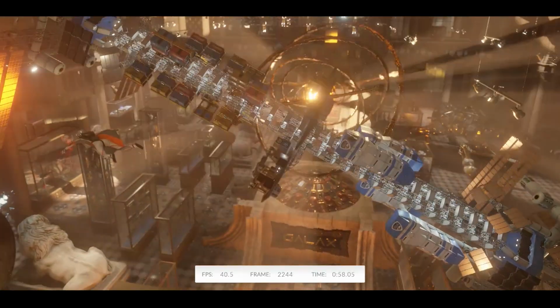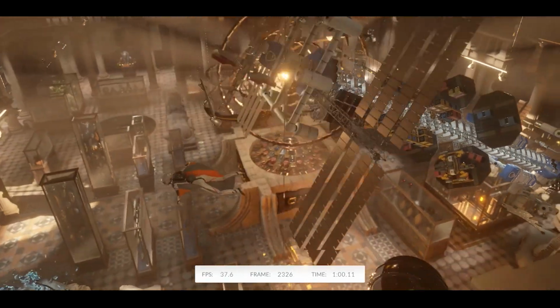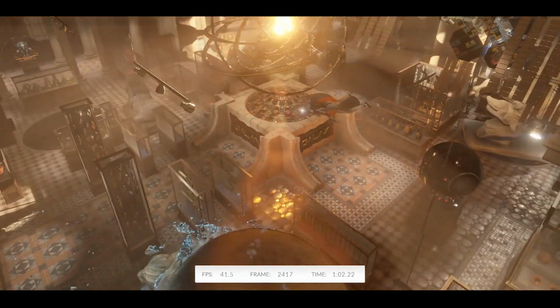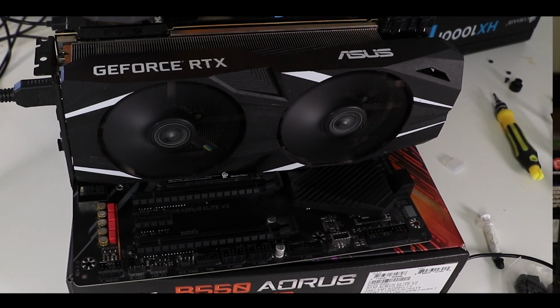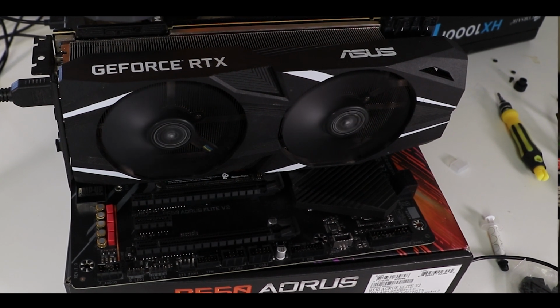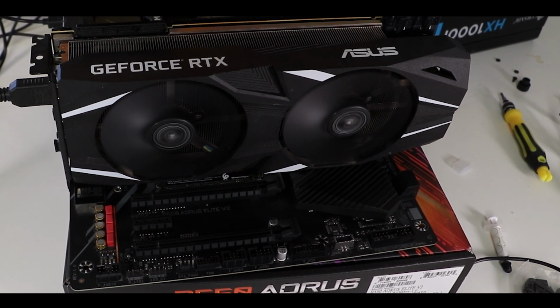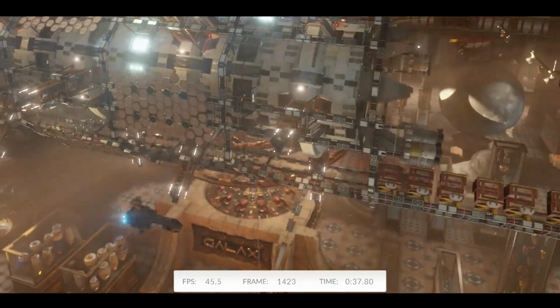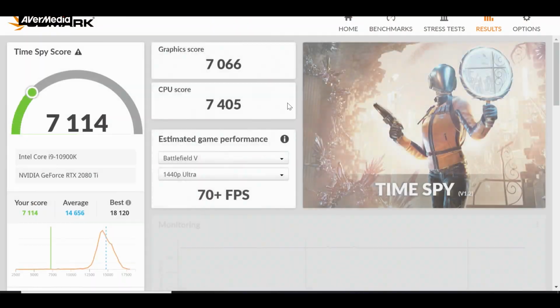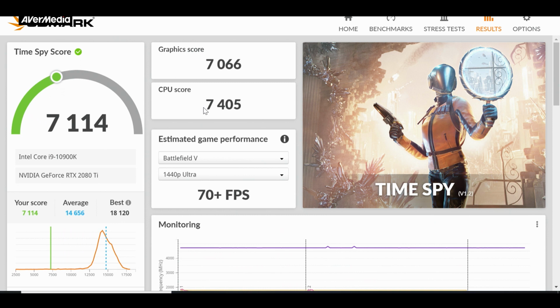Now, for my diagnosis, I have decided first to do a full 3DMark run on Time Spy whilst monitoring both GPU and memory temps, and results were telling. The card's fans went straight up to 100% as soon as I applied any kind of load to the card, and frames per second were much lower than what a 2080 Ti should be outputting. The video scoring was half of what it should have been, performing lower than a 2060 budget card.